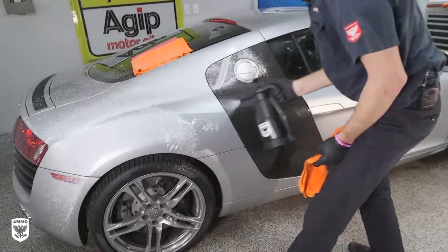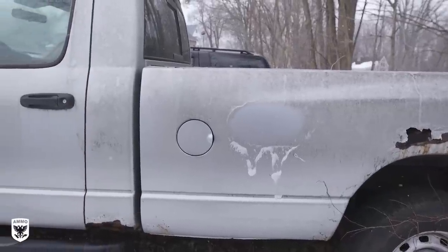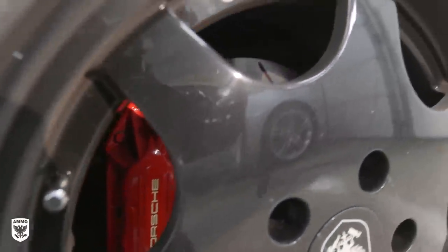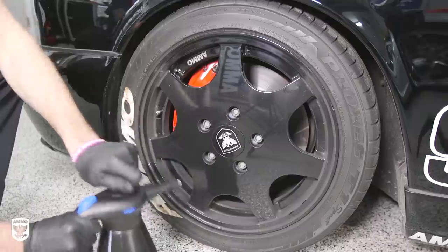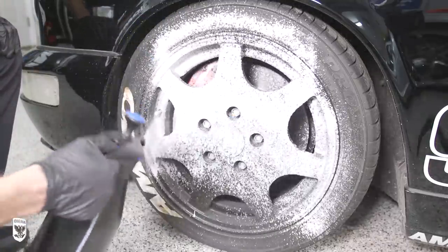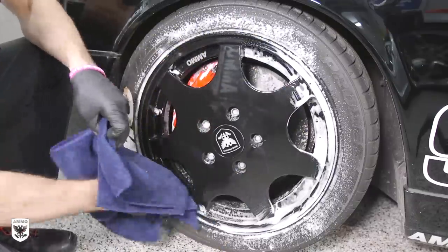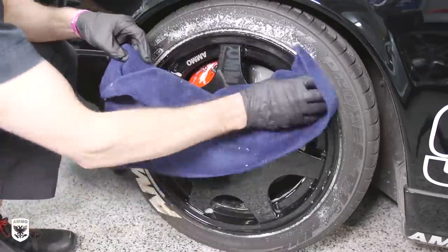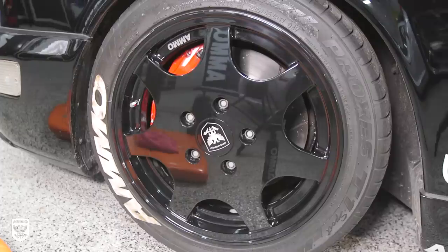Now that you get the idea of how to use it, I want to show Frothy in various situations, colors, and level of dirt to avoid any YouTube comments of 'Larry, it looks pretty good, but you only washed a kinda dirty car in silver.' Let's start off slow with wheels — they tend to get gross quicker than paint, so these areas need a thicker layer of Frothy and a different, in this case blue, towel designated for wheels only, not to be confused with red or orange paint towels. Avoid warm or hot rims, but otherwise it's safe on all wheels and will not remove Gelee, Reflex, or Skin protection — it actually leaves a light layer of shine behind. Be sure to rotate and switch blue towels as they become soiled.